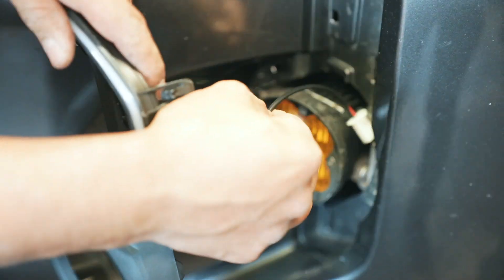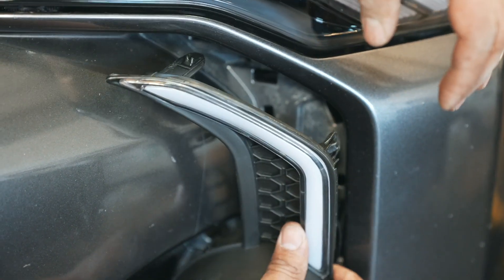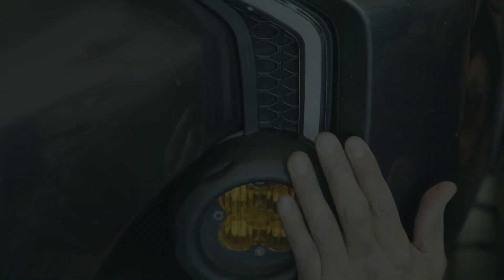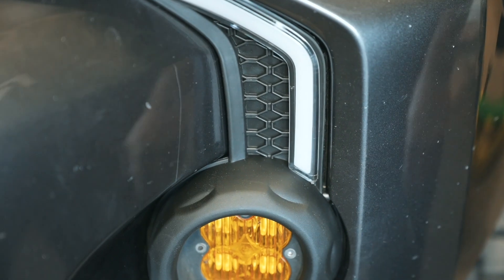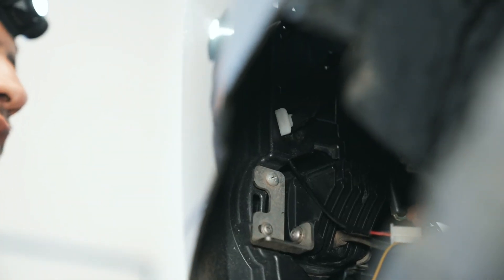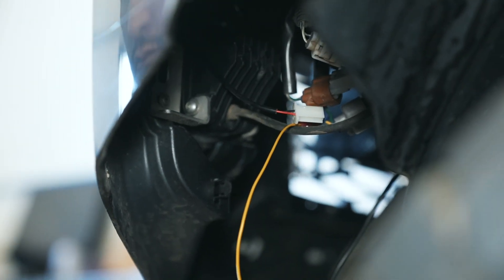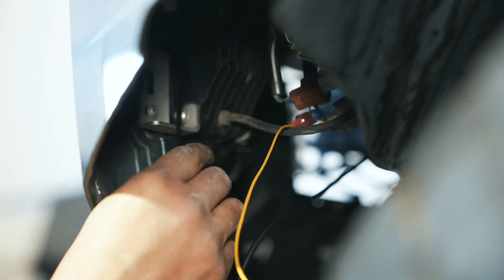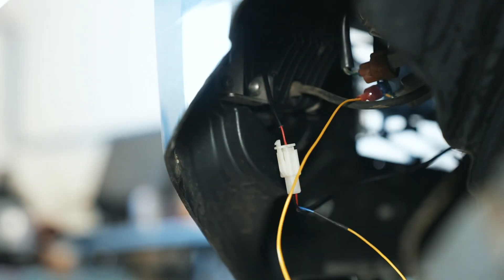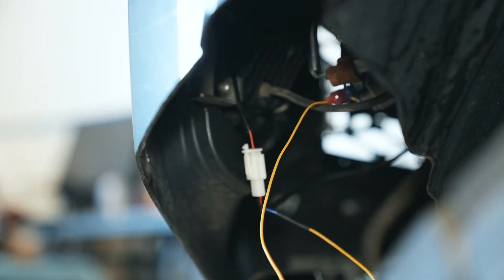On the front side, feed that wire through the hole right here. Then just like the factory bezels, find all the factory clip locations and apply a little bit of pressure to have it clip into place. If you have the white clips that you pulled off on the back side of your factory bezel, reinstall those when you're done with all the other clips — that'll hold that part together. Then with your connector from the bezel, plug that into the wires from the module. Once you've done that, clean up all your wires with the zip ties that are provided.